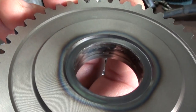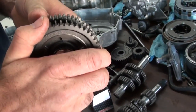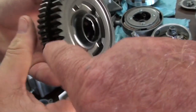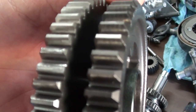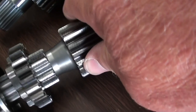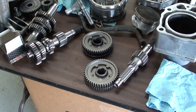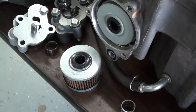You can see where those gears burned up. And with the gears being seized up, the owner — not really understanding what had happened — was trying to force it through a couple of gears, and it actually knocked a couple of teeth off of one of these gears. Let's roll it around and find it — there it is right there. There's a gear tooth missing right there, and also on the shaft itself, right there, there's a gear tooth missing. So we're having to replace an entire shaft and basically several hundred dollars worth of transmission gears and a boatload of labor, just because they put their oil filter in backwards.